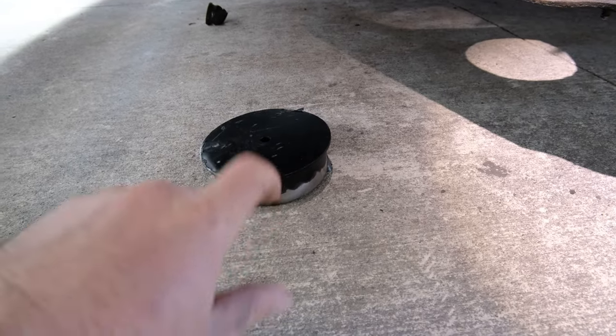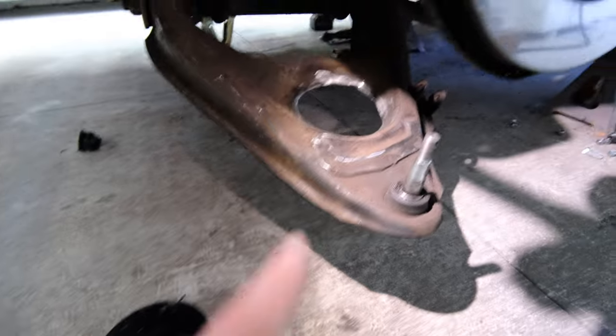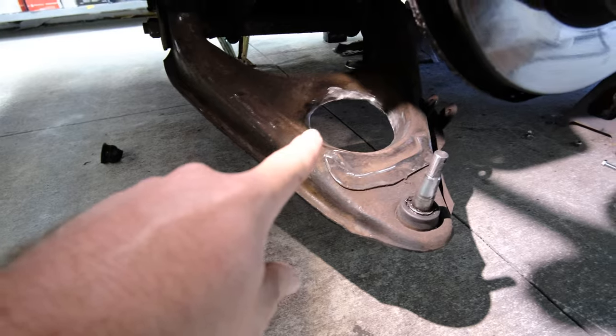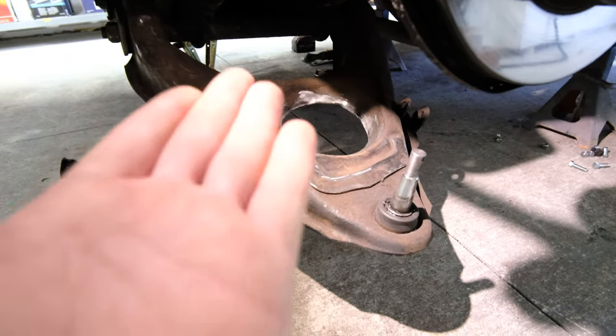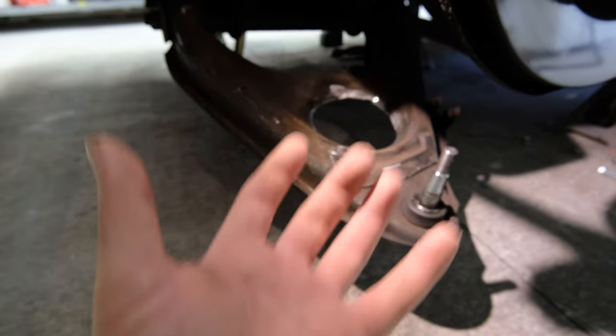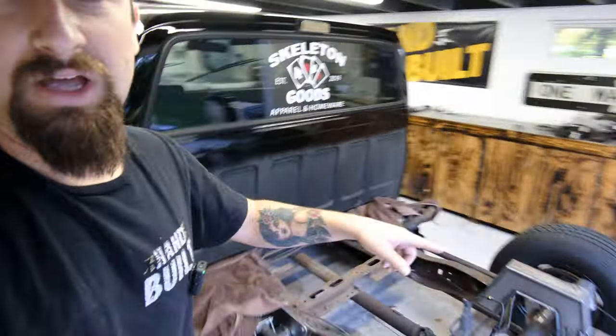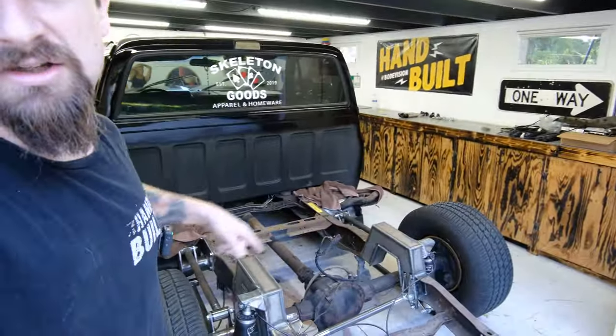How this kit was originally designed is the bag is supposed to sit on this two-inch plate, and that sits in the lower control arm. That has a little bulge where this fits in — the bulge is where the spring used to be. So what I'm going to do is plate that off completely. Hypothetically I could drop it as low as I want to gain as many inches as I want. In reality, the bags are supposed to have free space and nothing touching them, so I can't go too much lower because I don't want them to get pinched. I think I need some more metal for this area — I want to connect those two together. So I'm going to run to the metal store real quick.